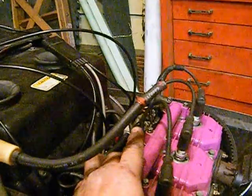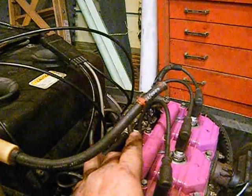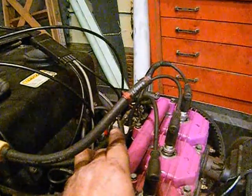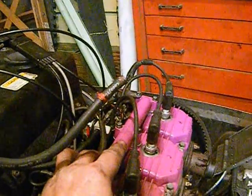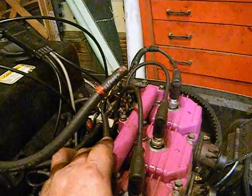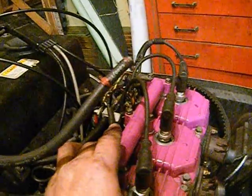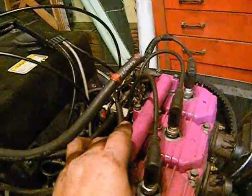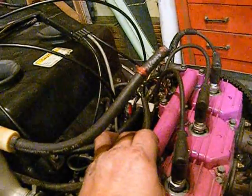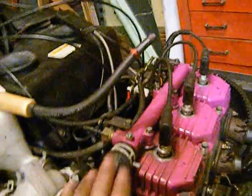While I was hooking up my ignition, I pulled it over to check to make sure I had spark in all the cylinders. My PTO side had no spark in it. I looked at my coil and the wire was pulled out of my coil. So I had to dig the wire kind of out of the coil, and then I soldered the wire back on. It's kind of marginal — I'll probably buy another coil pack on eBay.